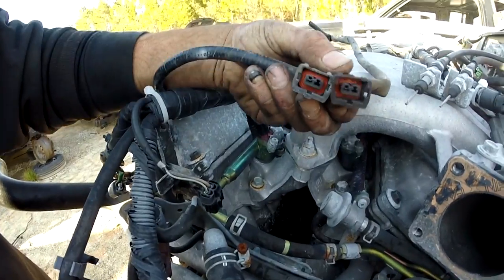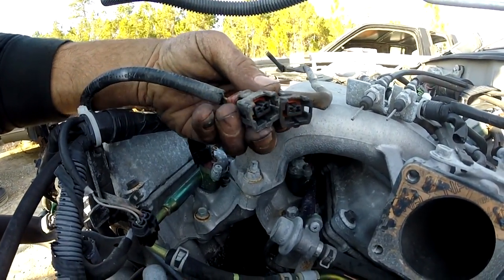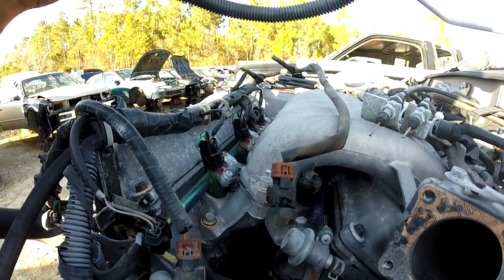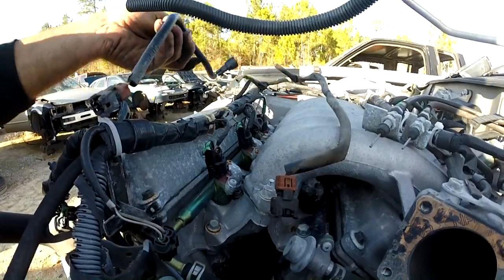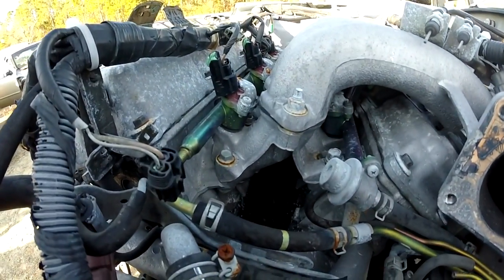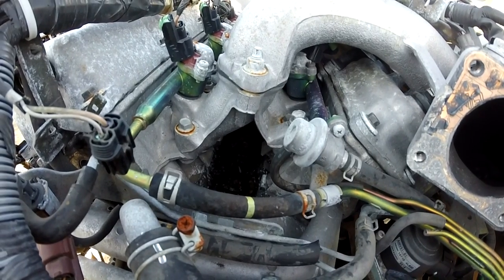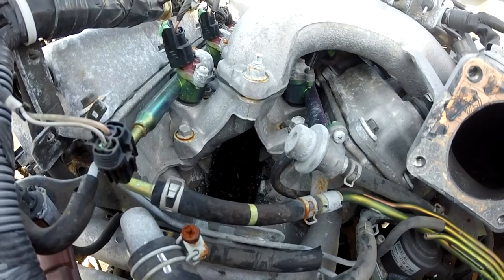Now the Xterra plug is on the right and the Maxima plug is on the left, and they're pretty much identical. They have a single pin in there, single wire coming in. So what we're going to be doing is splicing into the Xterra's wire harness with the new one. We'll be cutting off this, and I'll show you how to do the splice. That just shows you why it's so much easier just to go and find a Maxima, or order the new one. You can get a new harness for about 13 bucks off of eBay, and we'll put that part number in the description. So let's go ahead and get this back to the shop and get it put back together.